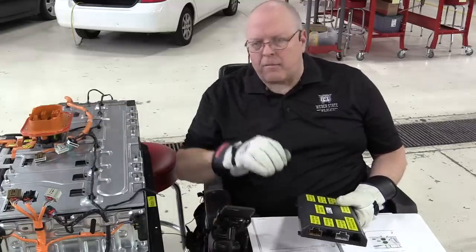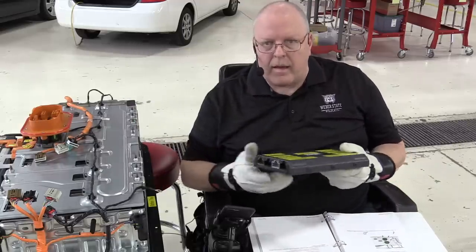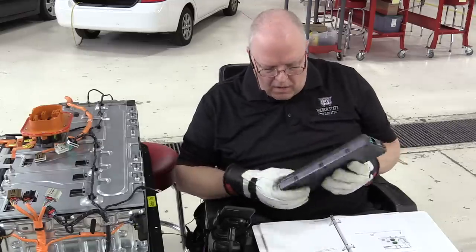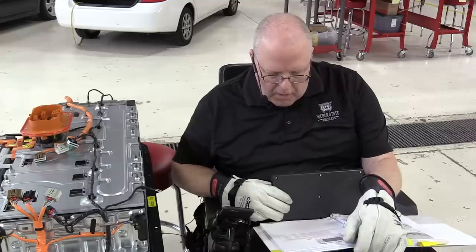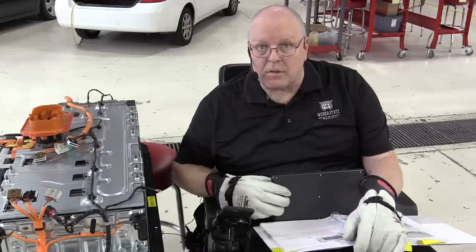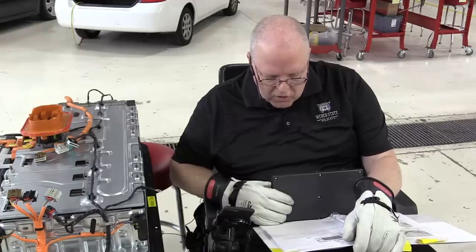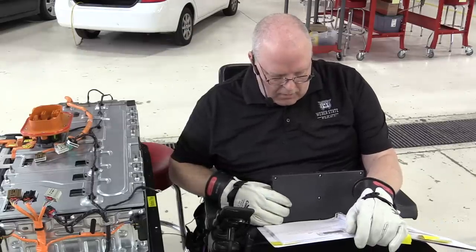Okay, we are here at the back of the battery on top of battery section 5, ready to install the BECM. And I want to read to you the warning right out of the service information about disconnecting and reconnecting the BECM. So here it is right here. The battery energy control module's internal cell balancing circuitry is powered by the cell group voltage sense circuits. So even though we're not hooked to the vehicle, it's self-powered. In order to prevent an unrecoverable, unbalanced hybrid EV battery section or internal control module damage, always take the following actions. And there's three things.